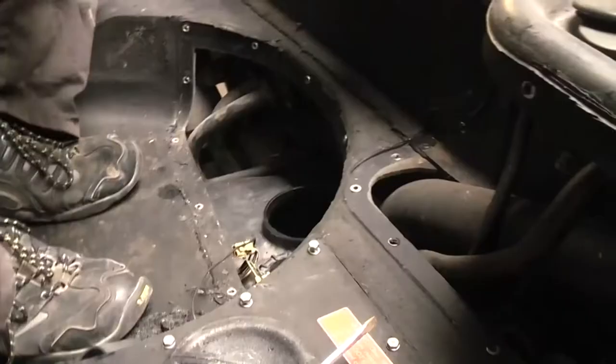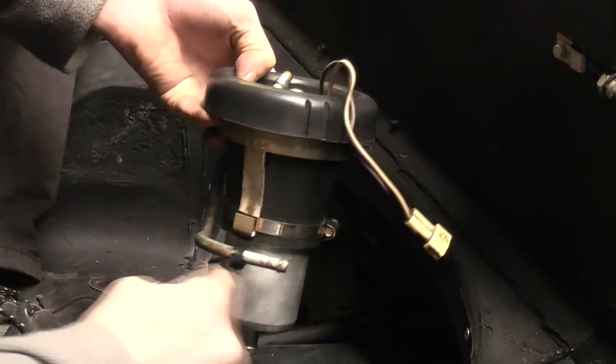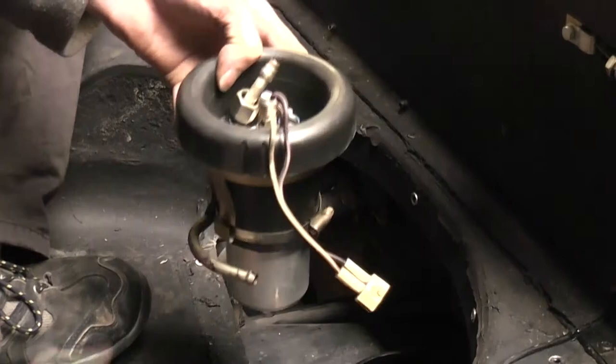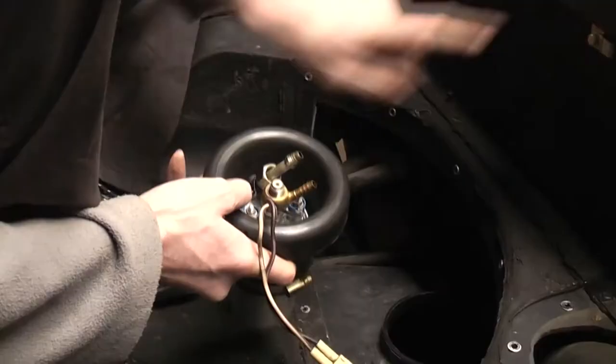Now we've got to hook up the fuel pump. This is how you put the pump in and how to make sure everything lines up so you don't get any troubles with a whining, noisy pump because it's struggling to suck fuel up. First things first: get your return hard line in. You'll notice this one — fairly good condition — is actually an original one. When you fit it, you'll notice that it wants to point out at a certain angle. Counter-intuitively they actually point towards the back of the car, and the hose actually has to do an S to get down to the hard lines on the chassis. But trust me, this is actually how it's meant to go.